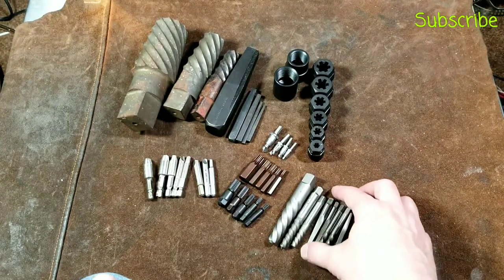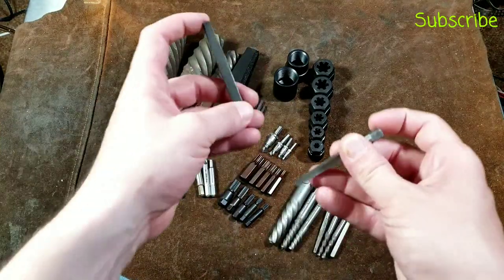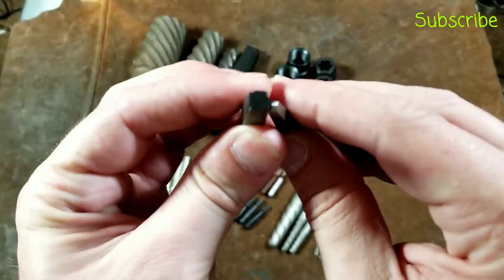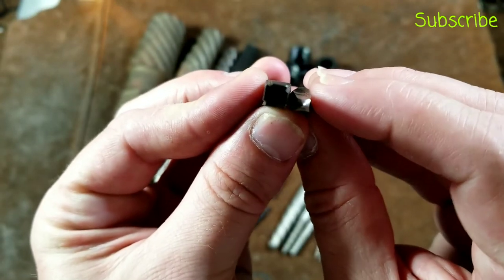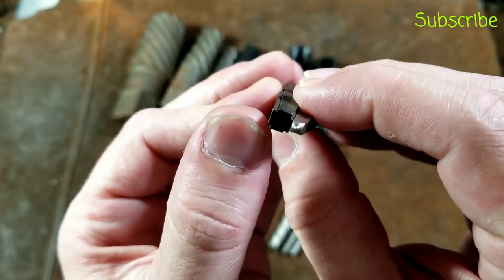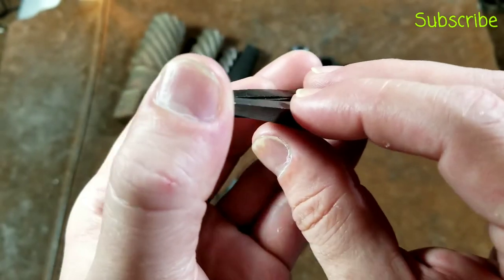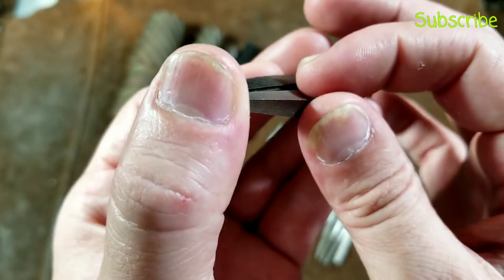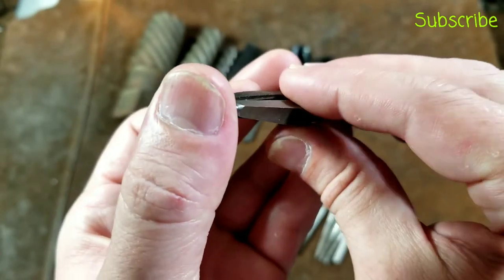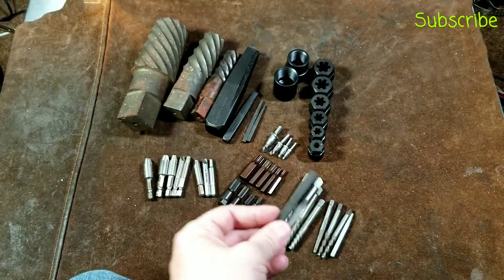I want to show some unique designs down here — these ACES compared to these Protos up here. The ACES were really nice because they had a concave four-point profile. The ACES will wear out quicker and aren't quite as thick for a proportional drill size as the sawtooth version, which is why sawtooths are more popular now. But a big advantage of the ACES is that in softer material these large ridges from the concave cut really dig in deeply and give a lot of traction. They're not as common because it's more expensive to manufacture a concave shape.